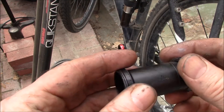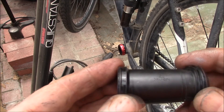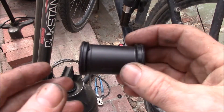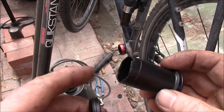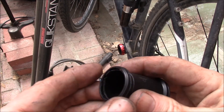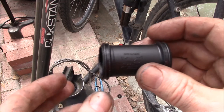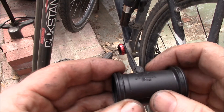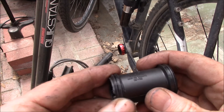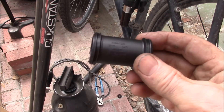One other part I forgot to mention: this is the tube that goes in between the two bottom bracket bearing shells. This is the original one that came with my Shimano bottom bracket. It turns out there's a ring that's thicker and then it's got the thinner tube in the middle — you can just cut those free and it collapses down as short as you want. I'm going to put a little adhesive in there, set it out wide, and when I press it down it'll fill up the gap in there.